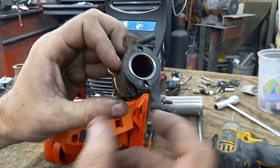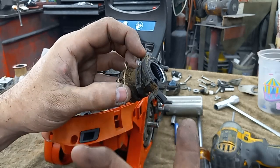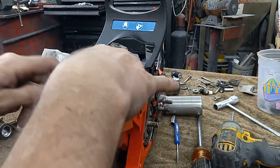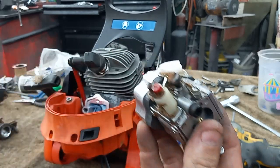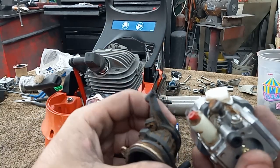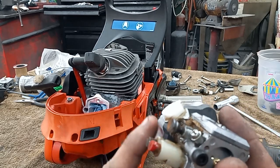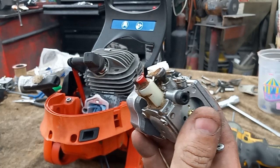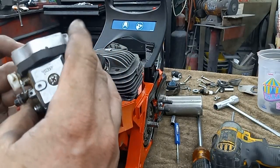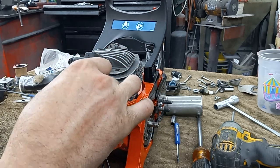I think I'm going to order — this is plastic — I see they've got some metal ones, aluminum or die cast. I'm hoping they're aluminum because for a 372, I hope I can order one, cut off the section I need, and then figure out the placement of where I want it. Then I can TIG weld it wherever I need it to hook the throttle cable up. But if I can't, maybe I can drill and tap it, or figure out some way to make a bracket and bolt it in.